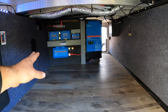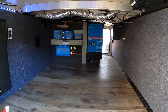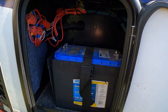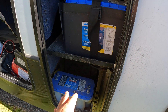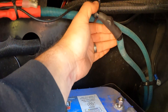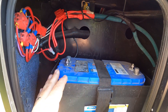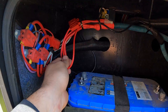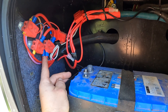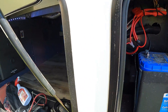In the old battery bay, we left those original batteries in there. We disconnected them from being in parallel, then used a nut and bolt to connect the terminals with heat shrink over them. We tested starting the generator and running through that line, and it's working just fine. There are also little thermal breakers on there that keep everything in check, so I think we're in good shape.